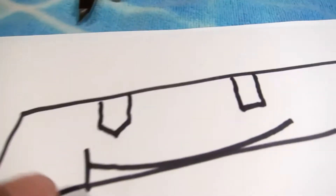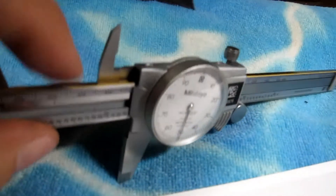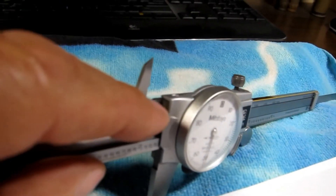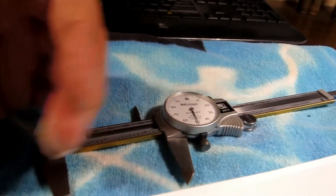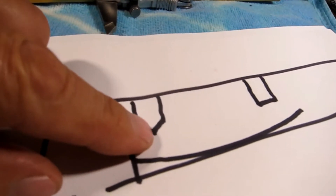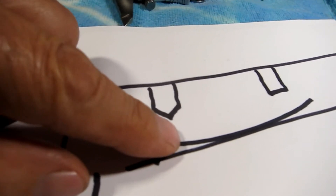You get the shim in there with the hump down. The end of the shim just barely is right in there, like ten thousandths below the surface — you'll see it. So you put it in there, the hump is down, and the hole is on this end, not that end. You put it in there maybe five thousandths past the metal here, and that's what lines the hole up. Now when you tighten this down, that point goes into the hole and wiggles it into position and locks it into place.